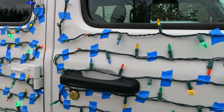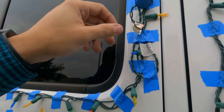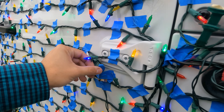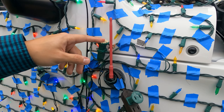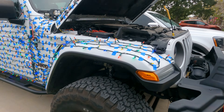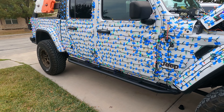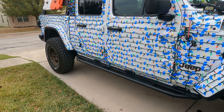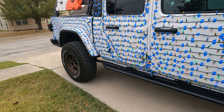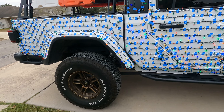Another thing I recommend is to tape the plug side of any lights that you connect — just to prevent any water from entering, staying inside, and creating corrosion. And I want to stress: LED lights, LED lights, LED lights. Use one simple strand of incandescent lights and you're pretty much done with your project — your inverter won't handle it. With these LED lights, I'm able to keep the Jeep off and have them powered to the inverter without any issues.